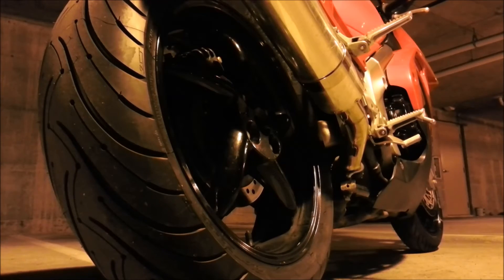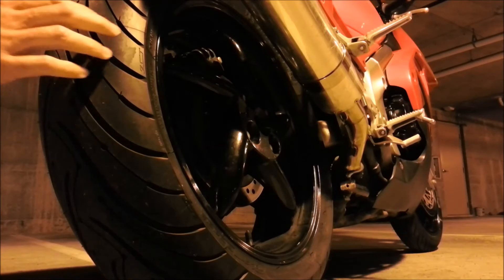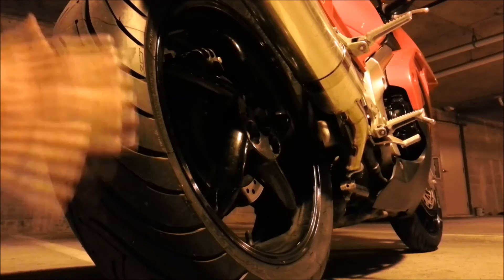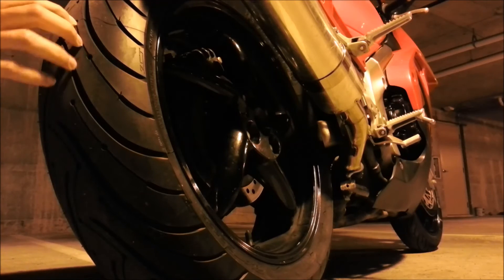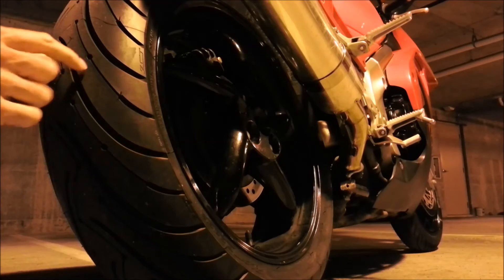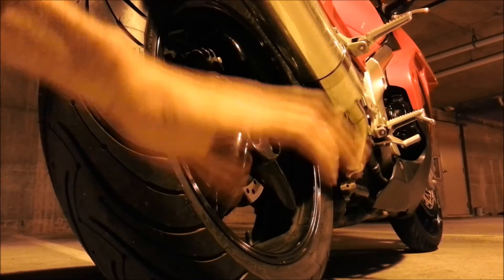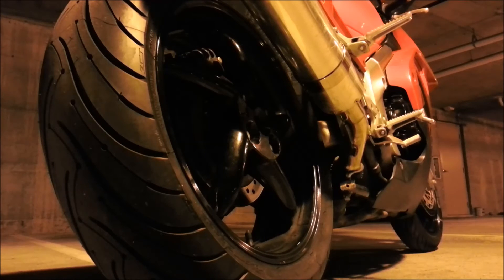Alright, so here you can see the tread profile on this Michelin Road 3. You can tell it's a pretty aggressive street tire, but it's got a lot of wet weather siping for sport touring. These are actually pull channels for water — when the contact patch is smooth on the ground, the water will pool and then dissipate out of the sipes. So this is really good technology for sport touring guys who like to ride spirited or aggressively on the streets, and then also do some distance travel, commute, whatever. It's probably the best commuter tire out there, I would say.